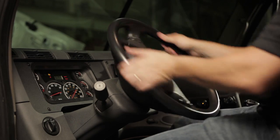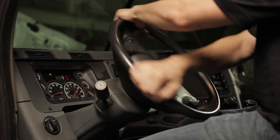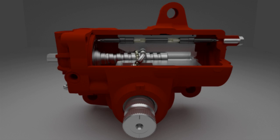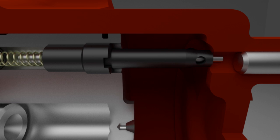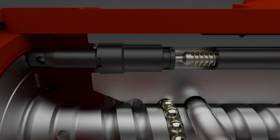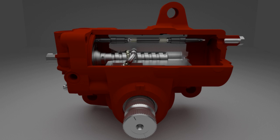Start the engine and let it idle. While the engine is idling, steer the vehicle in full right and full left turns, applying approximately 40 pounds of force to the rim of the steering wheel at the end of travel in each direction. Turning the steering wheel to full ends of travel in each direction moves the rack piston in the cylinder bore of the steering gear. During this procedure, poppet sleeves on new or remanufactured genuine TRW steering gear are pressed to the appropriate position to match the steering angle set by the axle stops. The poppet seat and sleeve are a pressed fit, so the seat will stay in this set position until it is reset. With the poppet set to match the axle stops, system pressure will not exceed required levels once the axle stop is reached, preventing steering system and vehicle damage.